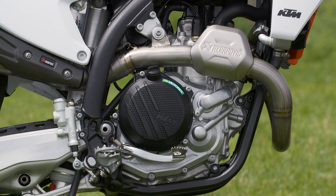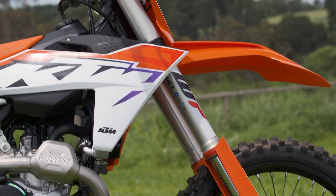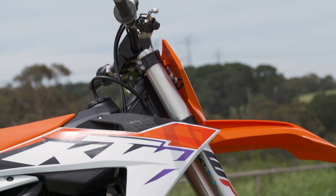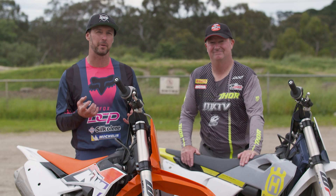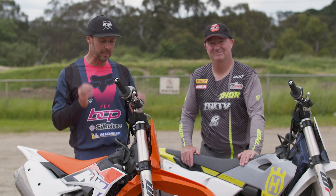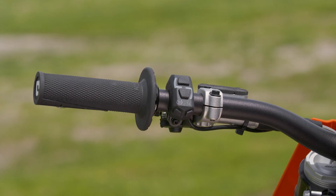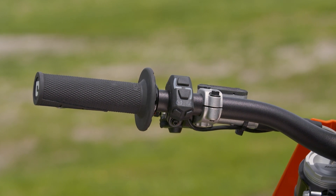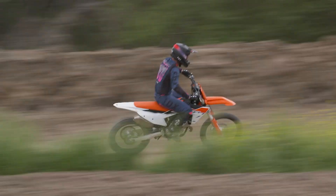The motor is super strong. The suspension is basically the same as what it used to be, however the bottoming cups have gone from 20mm to 40mm — you can really feel it on those big hits out there. One of the biggest changes we've got with the KTM is a quick shifter. It's been in road racing technology for a very long time, but a quick shifter has finally been brought into new technology with the four-strokes.